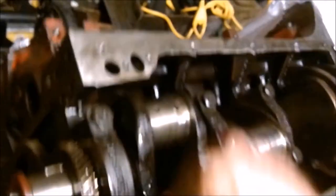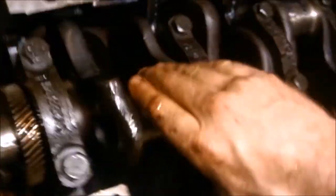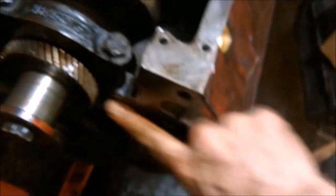Remember, it's a lot easier to spin with oil in here as opposed to this assembly lube — it's thick. That should give you an idea of what happens when you put too thick an oil or run summer-weight oil in winter. You don't want anything on the mating surfaces when you bolt them down. Understand that the crankshaft isn't metal-touching-metal on the bearings; it's floating on a thin film of oil — up to one-and-a-half thousandths of an inch thick — between the wall and the side clearance.